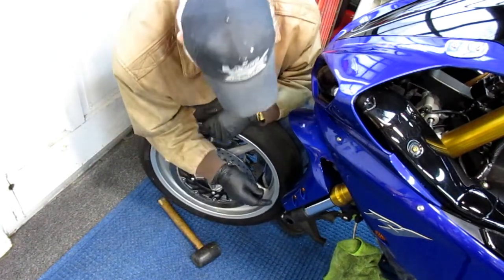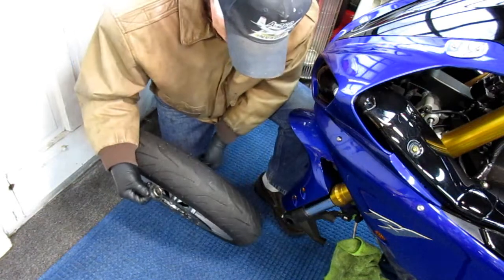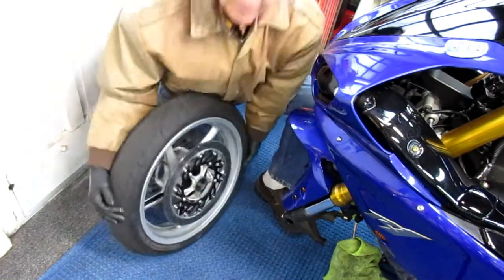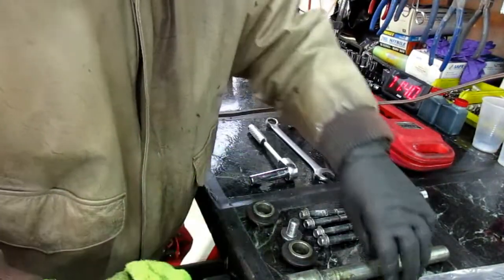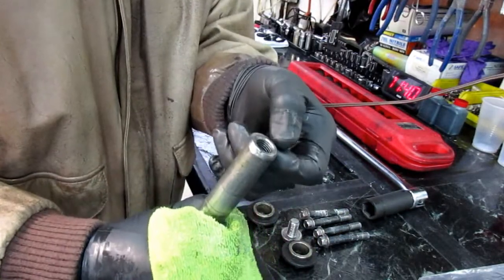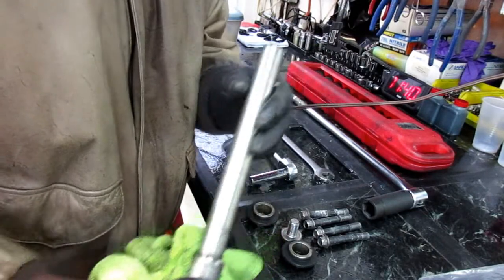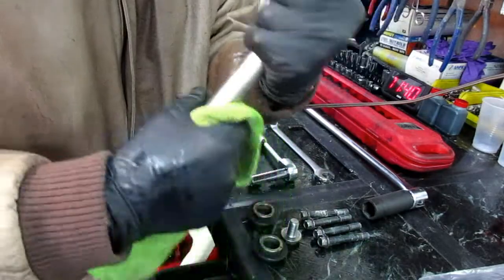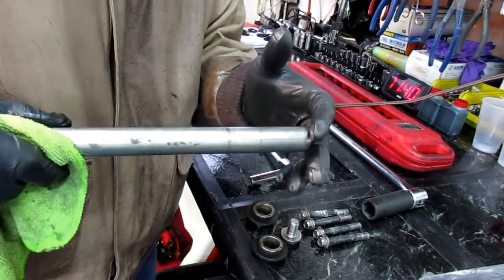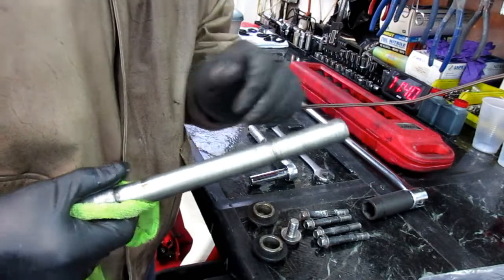It's a little trickier than that getting this back in — just like Chris's R6 wheel. But we did get it out. We take the two bushings out, re-grease these, clean them up, clean up all the hardware — they're symmetrical, so you don't have to worry which one goes on which side. Now, because I just worked on Chris's R6, I remembered a little modification I made to this axle — something you could do on a grindstone. Normally when it's stock it has a lip that makes it difficult unless you have a helper. So I just radius that off, and when it goes into the other side of the fork, it clicks right in. I think Yamaha should have done this right at the factory.